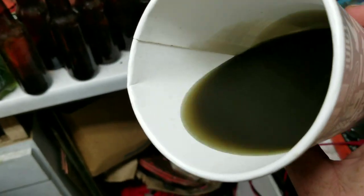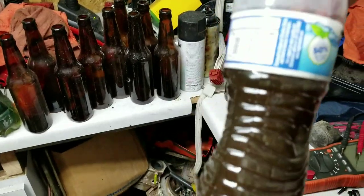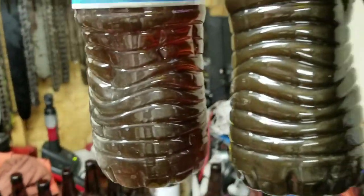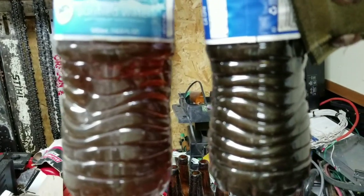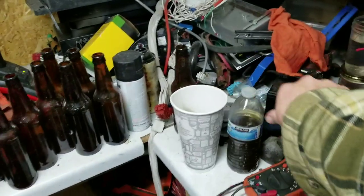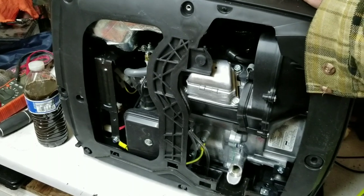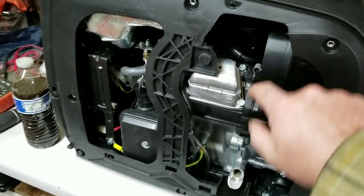I was talking to a buddy and he said the reason why this oil looks so horrible is because the rings were breaking in, and obviously the pre-lube ointment they used was doing it as well. This is the first oil I changed. Did that quick oil change — this one that I changed after a few minutes is lighter, but this one clearly has more contaminants. So far the biggest thing I'm getting at with this motor is heat — it's all about heat.